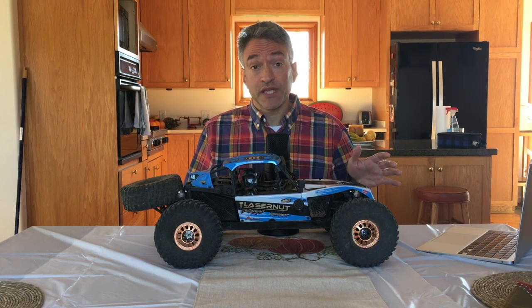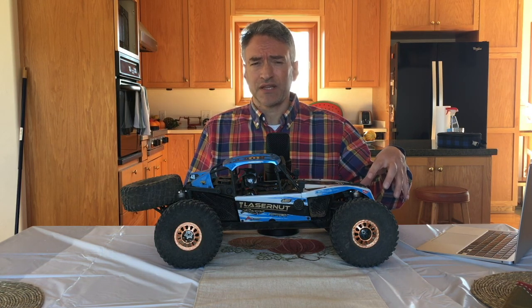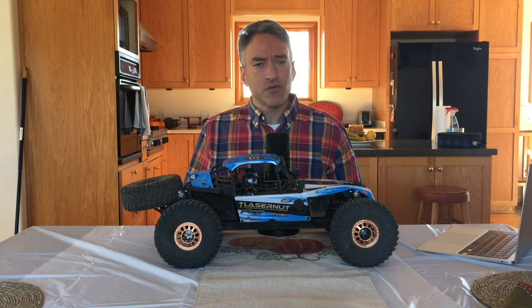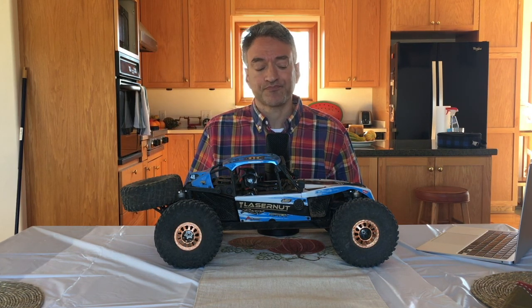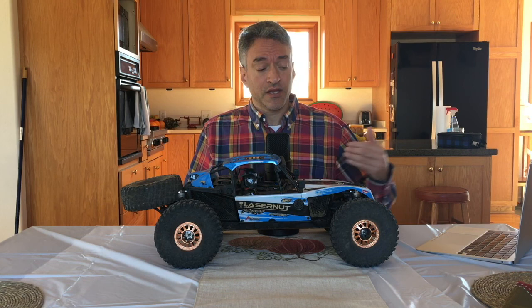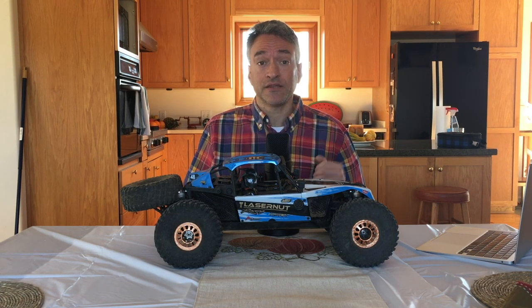We had two issues emerge, as you're aware. The front differential was clicking, and the clicking was getting louder and louder, and so I wanted to address that. But that really wasn't a durability issue, and to me that's more of a quality control issue. It came like that from the factory. The gear mesh between the pinion and ring gear and the front differential was not set up properly. We purchased some shims, and we're able to correct that, and the clicking went away.